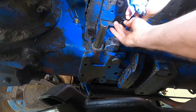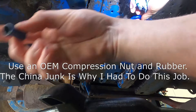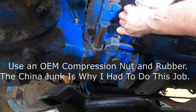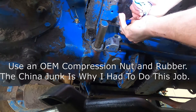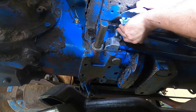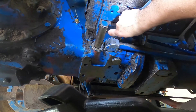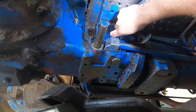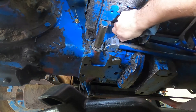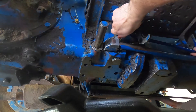Now what I'm going to do — the paint hardened on there — is remove this plastic cover which I left on when I painted it, install my nut onto the line, and make sure that the line is protruding through the actual rubber part of the nut. I'm going to bring it up into place and this should thread in by hand. If this won't thread in by hand, you are probably cross-threading it, and then you'll have to end up doing what I just did.